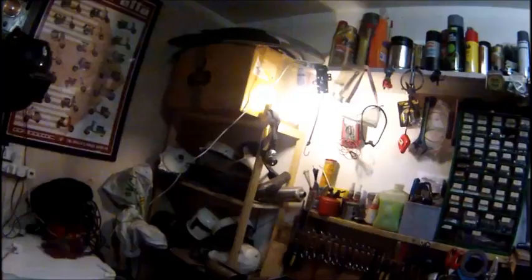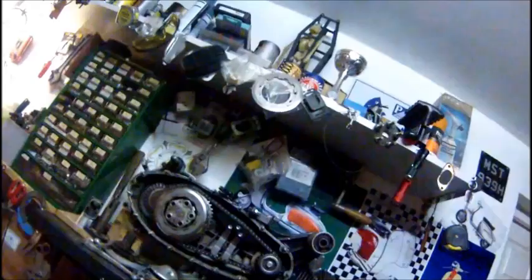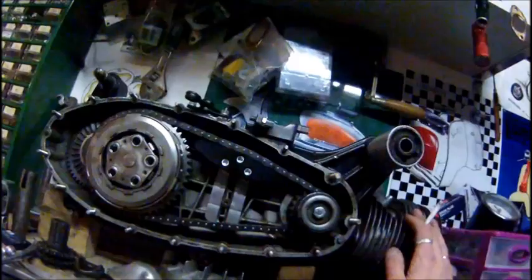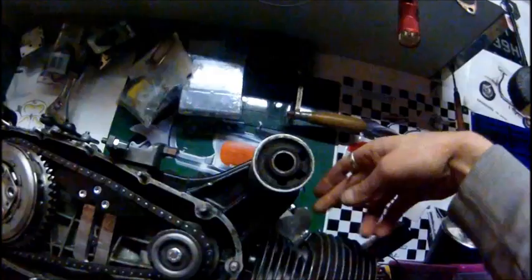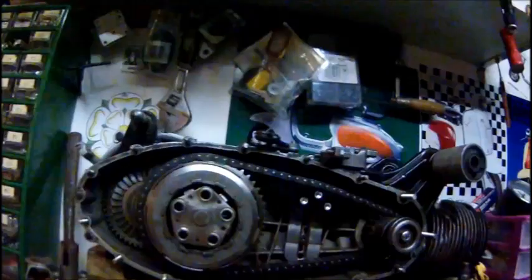This is the engine that I was working on before. I've made quite a lot of progress on it, but as I say I haven't really been in the mood to do videos. I just wanted to get my head down in the garage and keep myself busy. I've put a top end on it now — this was actually one of my dad's old ones from the shed. It's a Rapido 225 that I've ported and matched the manifold, the exhaust windows and all that, cleaned them up and polished it up. I've got all the clutch in as well. That should run pretty nice.